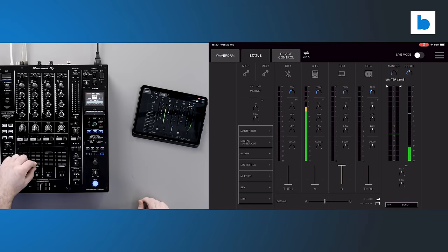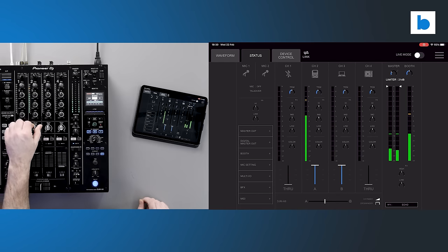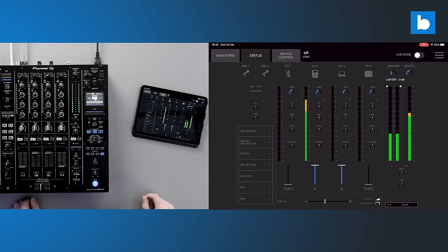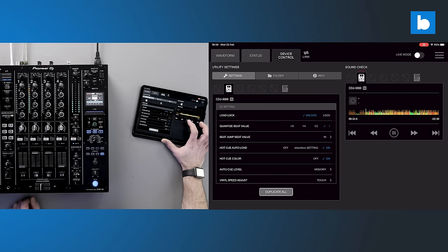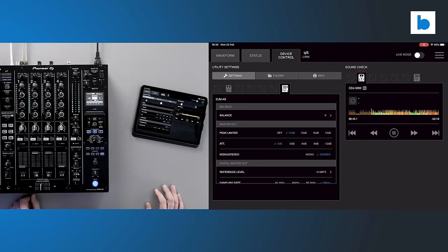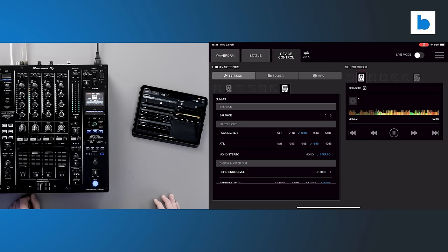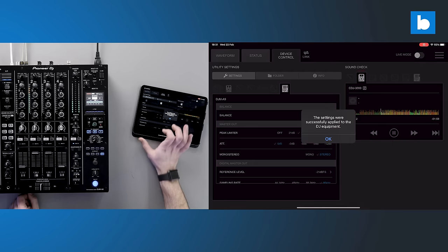The second feature using the antenna is Wi-Fi. That's not for connecting the mixer to Pro DJ Link wirelessly — that would be pointless as the CDJs need hard wiring anyway. Instead, the Wi-Fi connects to your router and then to a new iPad app called Stagehand. It's not for DJs — it's for venue sound engineers to monitor everything going on with the A9 and even adjust settings on the fly, like pulling down the master attenuator for DJs who constantly redline the mixer. I think the app is a fantastic idea, but there's one big issue: it costs $20. The idea that Pioneer DJ would try to squeeze an extra $20 out of businesses who've already spent nearly $3,000 on a mixer for a utility app is frankly absurd. It should be free.